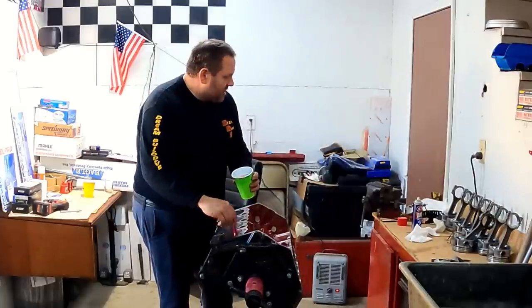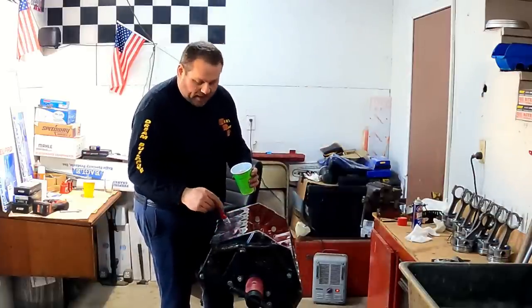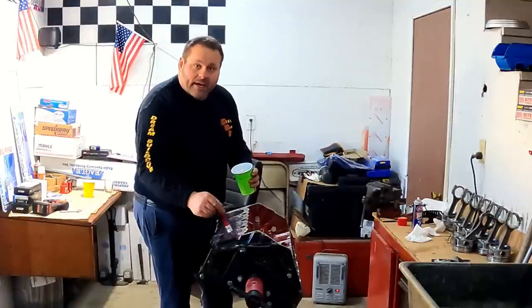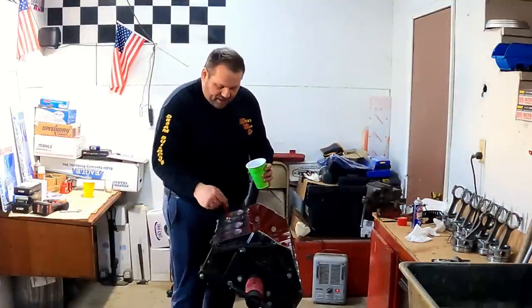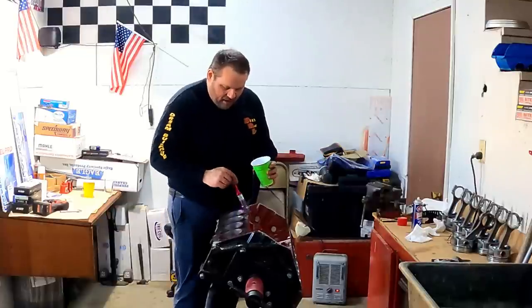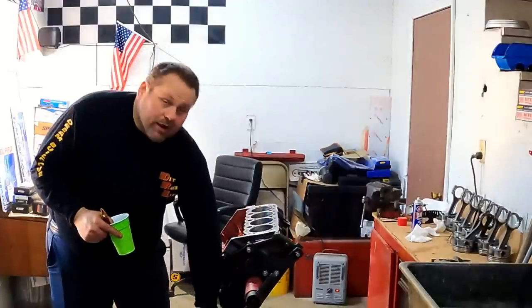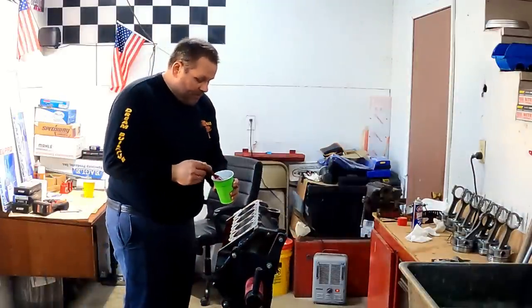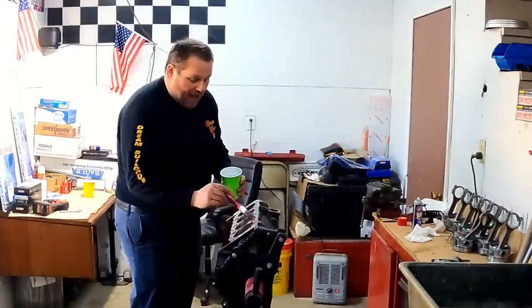Dryer. It's not WD-40, it's the STP brand, but the same thing as WD-40. Spray everything down with WD-40 because it'll grab that water. But this is just transmission fluid right here. I'm gonna come right back and wipe this off. But yeah, when you wash one and you really get it clean like that after you've honed it, they are gonna flash rust. I mean, literally right before your eyes.